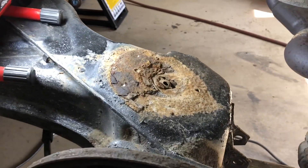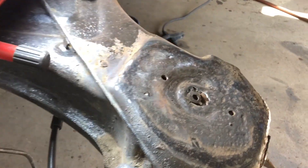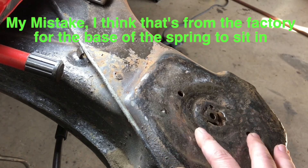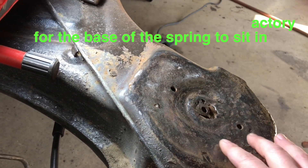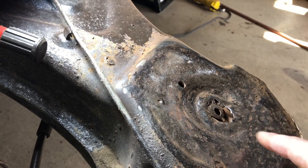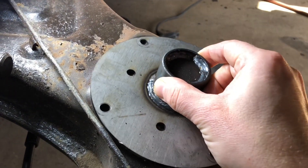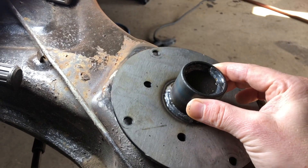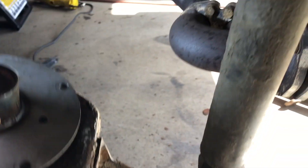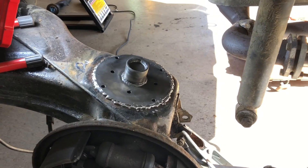What I'm gonna do now is grind this up and clean it, and I'll show you what it looks like just before I weld it. We've cleaned it all up - as you can see, the spring actually indented it right in there, pushed in a bit, but that's okay. The biggest thing is these two holes are still here; those are just drill marks from where I drilled it out. You're never gonna be able to get all the rust off, so just strip off a good layer for your weld to take hold. Those two holes are gonna line up with this hole and this hole, and then this is just gonna go right on top and we're gonna weld it around. I did a little score around here - took a razor blade and scored around it, so you can see the line there.